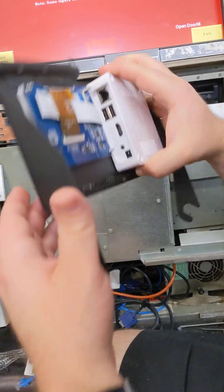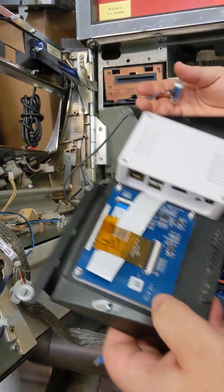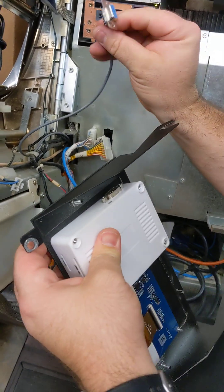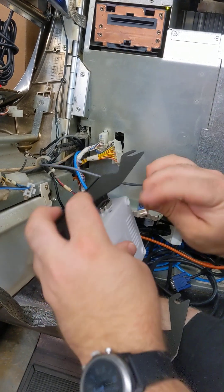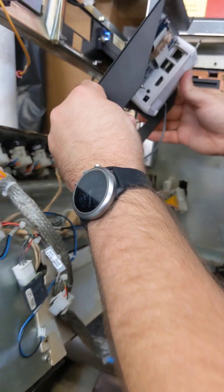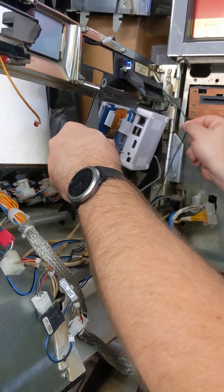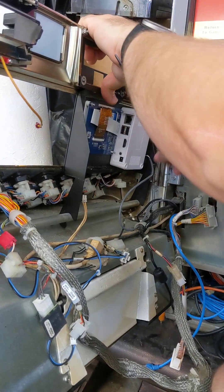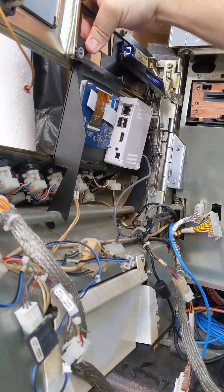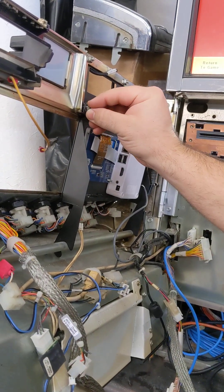The easiest one to put in first is the nano housing unit — watch out for this. Before you put it in, you can hook in the COM cable; it's a whole lot easier to hook up when it's not in there. The larger side goes towards you, towards the front or the back of it. That slides in there. Make sure those cables are fine. This attaches here — these little hook things. This has to go in front of it. Make sure the screw all the way in the corner goes over; if you need to use leverage to get it in there, you can push the front piece against it. Then put these on a little bit — don't tighten them yet.